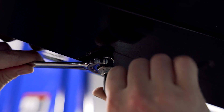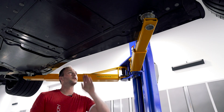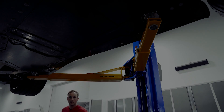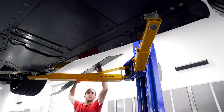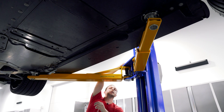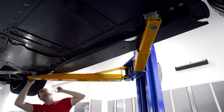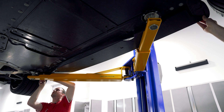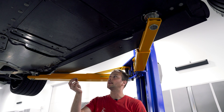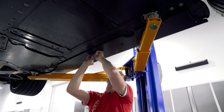Once you've tightened it into place, just unscrew the allen and repeat that same process for all the other holes, installing the riv nuts. Once all the riv nuts are installed, set the barge board back up into place. Start by taking the two 7 millimeter screws from earlier and installing them loosely at the rear. Then using the supplied 4 millimeter headed allen screws and a washer, go through and line them all up and install them into the riv nuts.